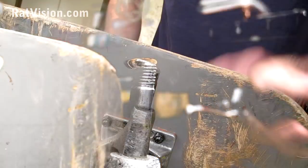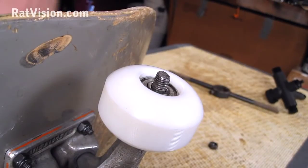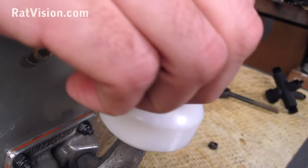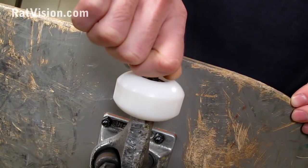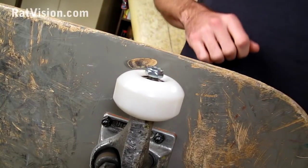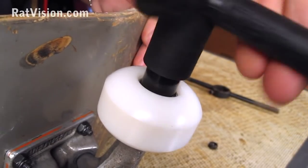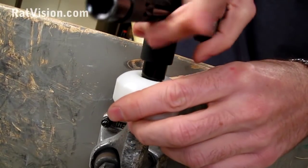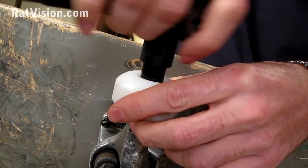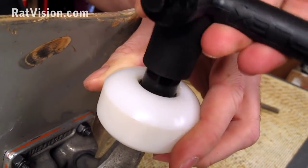Now I'm done. All I've got to do is stick on a little washer, put my wheel back on, stick another little washer on, and start screwing on my nut by hand, then take my tool and start tightening it. When you're tightening a nut, you don't want to tighten it all the way down to the bottom because you can crush the shield or seal into the bearing and totally damage it. Just tighten it and check it along the way — you want to give the wheel just a little bit of movement so it can spin.